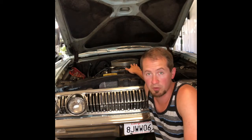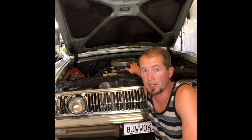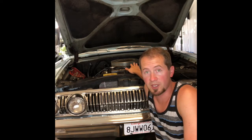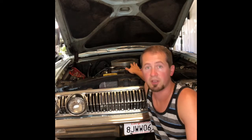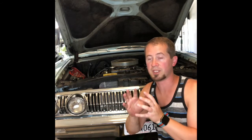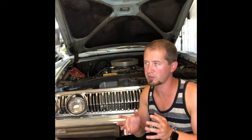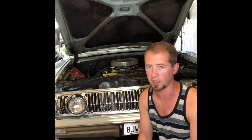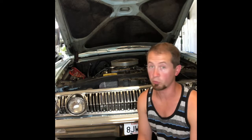So I finally went to timing control. I put in an MSD billet distributor and now I'm using that to adjust my timing. Now another caveat: at idle with timing control, it can adjust and maintain your idle by moving timing a little bit. So it's a little tricky to time right at idle — I'm noticing on mine it's jumping from about 12 to 16 degrees with a target of 14, about 2 degrees either way.